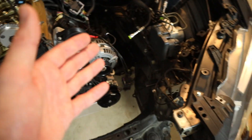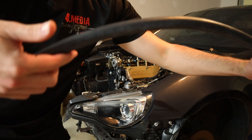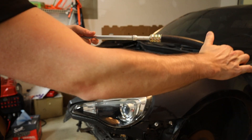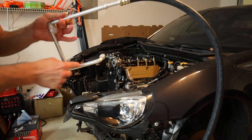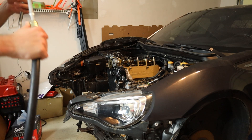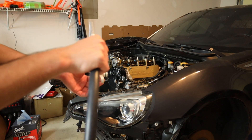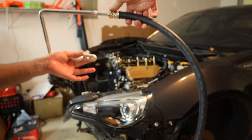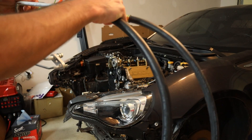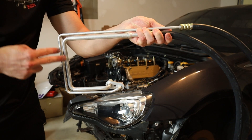Let's start by putting in our big line first — this one, which is significantly thicker than the other one. This end is essentially going to come over the top of the engine block, go down, back over, and then move backwards and fit into that little block we were just talking about. This little mounting bracket here will come all the way down and help hold the smaller line. If you've seen any of the K-Power images, you've seen these double lines running over the top of the engine — these are for your AC.